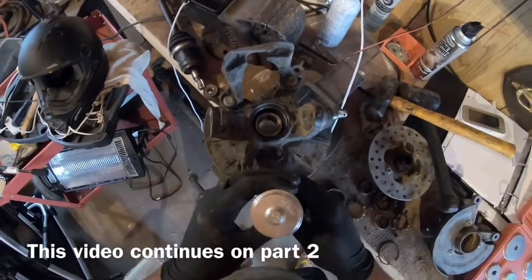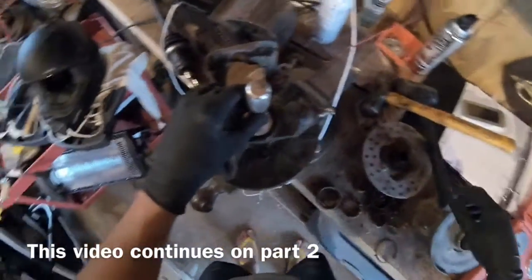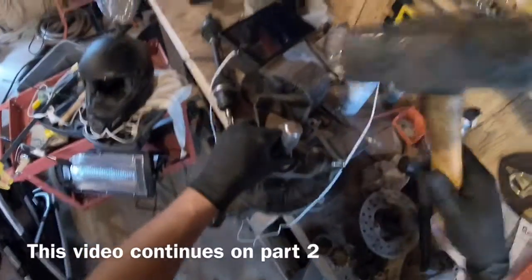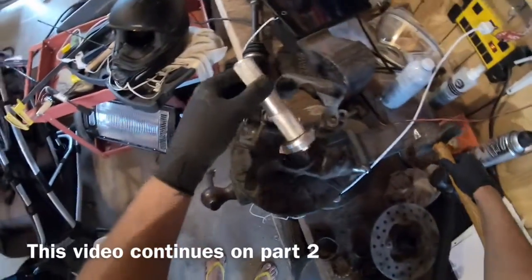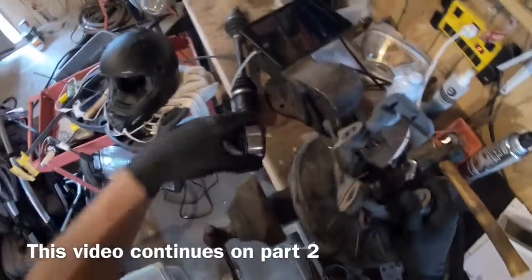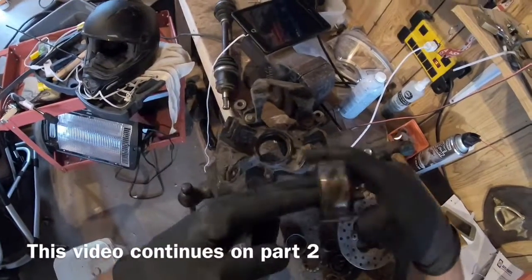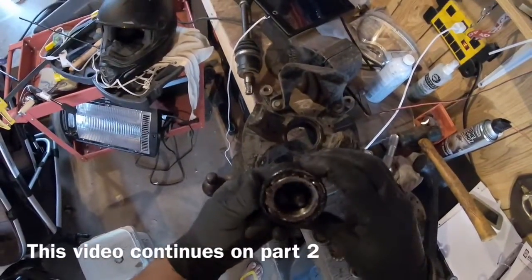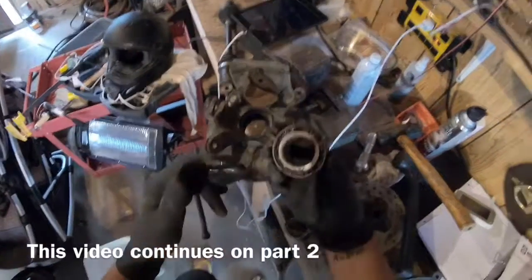I switched to a 44.5mm disc because the 50mm was getting caught on the edge of the race. I've also switched to a regular sledge for more weight. There we go — that's the bearing out. You can see it's still intact but a little rough and could use some TLC. It's got a lot of mud and dirt in there, which is common when you're going quadding — you end up in mud and muskeg and it gets into your bearings.